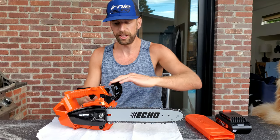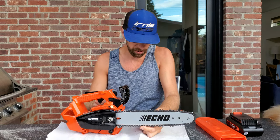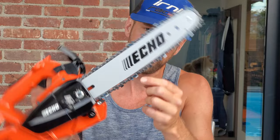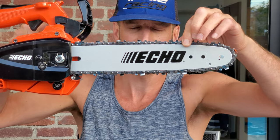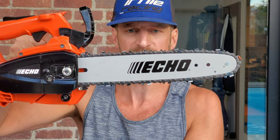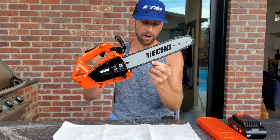Right now the chain is tensioned. The brake is back and you can see it's nice and smooth. If you pull down — give a really good zoom in — you can see if I pull hard I can just get it out of the gears. It tightens up as you go along; it goes loose and tight. Keep it in the tight spot — it just shows the sprocket gears slightly. This is perfectly tensioned, which means it's smooth and it's not coming off.